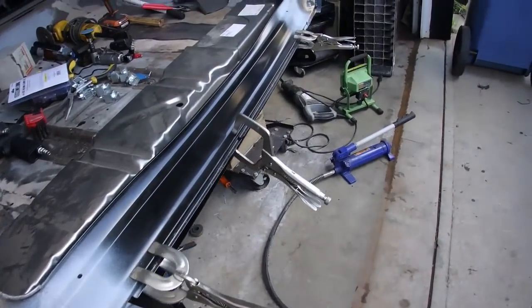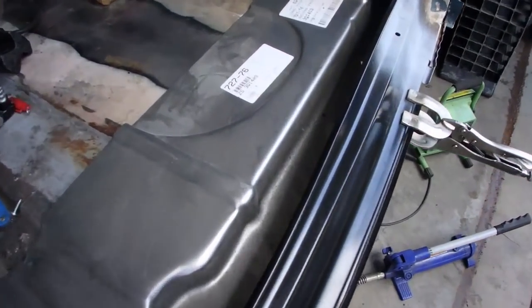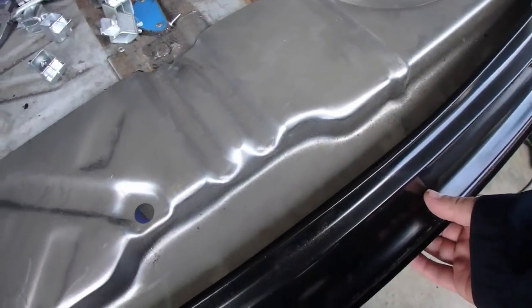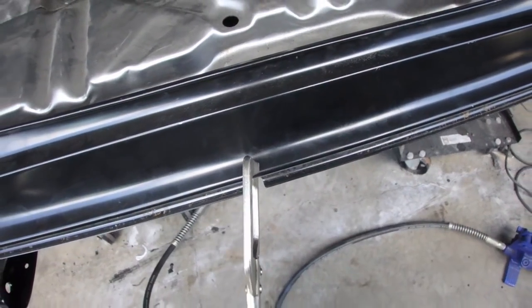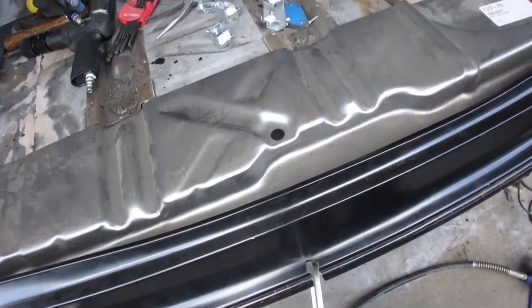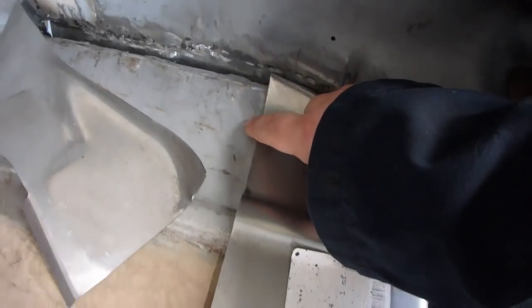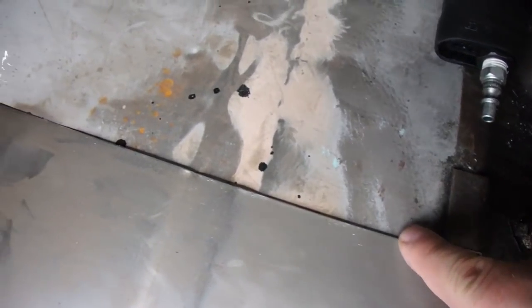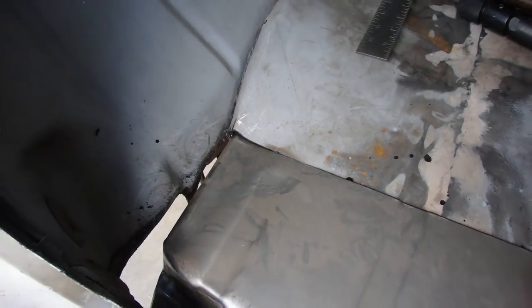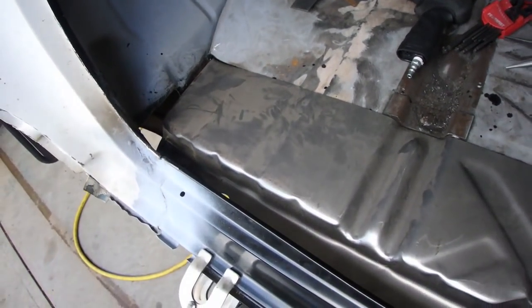So I very gently put those clamps there, and I put this piece in and butted it back where it's supposed to be, and it's lined up because there's a notch in there, and on the piece underneath there's a notch, and those have to be lined up. Now I'm going to take a scribe and scribe along here, because some parts are good, some parts aren't as far as fitment goes.